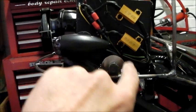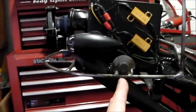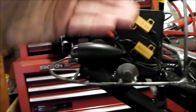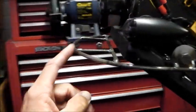And that means bracing over the top and down that side, so that I can then cut the bottom piece out. If I just cut it out now, it'll just go, so that won't be any good. It's got to be effectively braced over. And then when I bring the bodywork down, it will just find whatever is the right way that looks at the time to go in there. Same thing with the backlight.